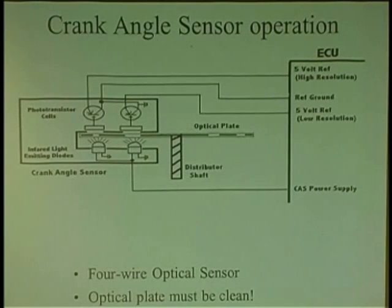And the last RPM sensor that they have that was out there, and it's still around, is an optical sensor. I hate them. Bad design. You have these infrared light emitting diodes, and they emit light, which the human eye can't see. They emit light through tiny holes that come across above them to this phototransistor cell. That's all it is. So they just shine light through 360 slots on the outside, and maybe, I don't know, 8 slots on the inside, depending on how it's designed.